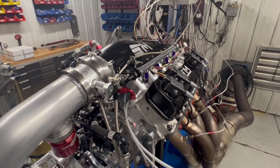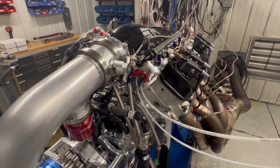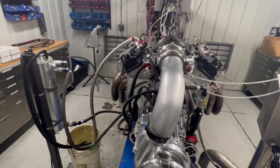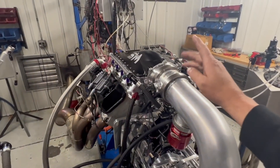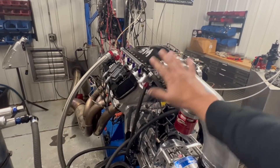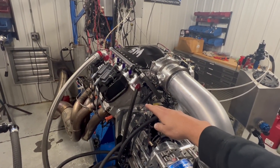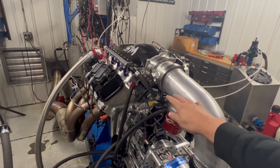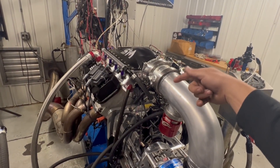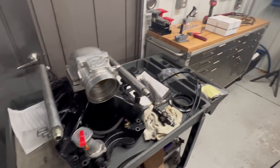Now this is something — coil-on-plug. These are smart coils, don't have the MSD600 on it. Don't really need it for this application. But what we have done here is been working on this intake manifold because this exact engine — everything here — the only thing that we have done is we've just freshened this up with a new set of rods. Everything else is exactly the same: same pistons, new rings, bearings, that kind of stuff. But we dynoed this when new with that manifold.